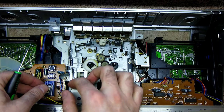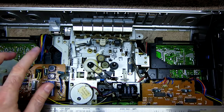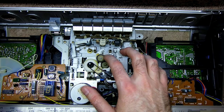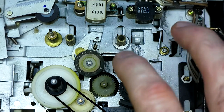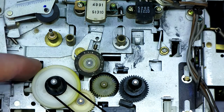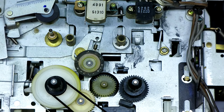I'm going to pop that back in, but that's just really amusing to me. I can see a lot of dust and muck down at the bottom here. I'm not too keen on the look of the rubber on that wheel — it's possible we may need to fit a new tyre to this take-up wheel. Actually, looking at it more carefully, it might be a rewind/fast-forward wheel. There's a serrated grip on the plastic pulley here, so I don't think it would be short of grip, but I just don't like the look of the rubber.